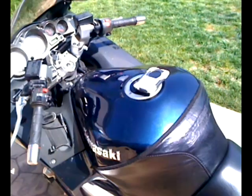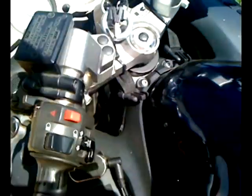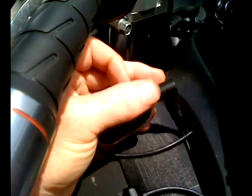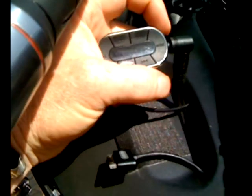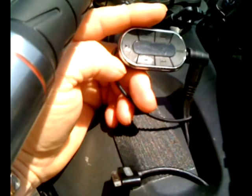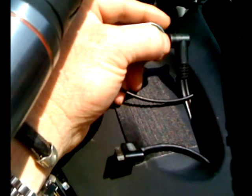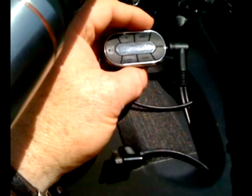First, my options for a head unit. I didn't want to put a full stereo in here, so I bought this little unit. It's a stereo — there's an FM radio and an iPod interface. This is the plug-in to my amp, basically where the earphones would plug in. The unit has a play/stop button, volume down, volume up, shuffle to go through the playlist, and a button on the end to switch between radio and iPod. I put a little velcro down, which is going to get replaced soon.